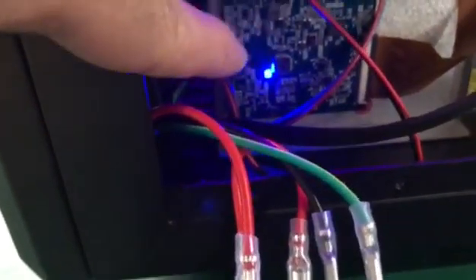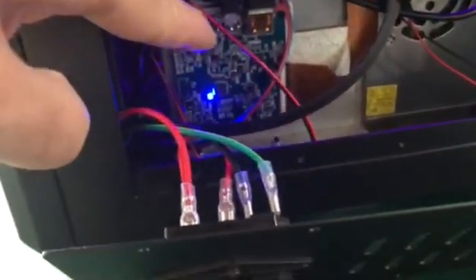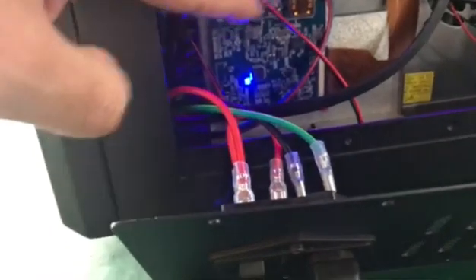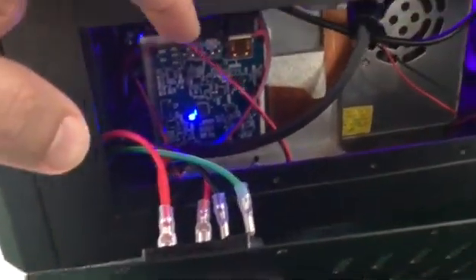You can see the light on the LCD controller board turns on and it's solid. If it's not solid and it's blinking, that means whether the HDMI cable or the LCD controller board itself has a problem — they don't receive the right signal. So if you have an HDMI cable available, you can try and replace it.